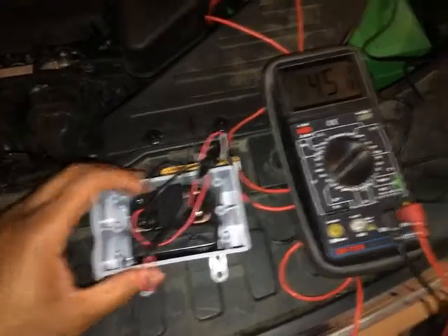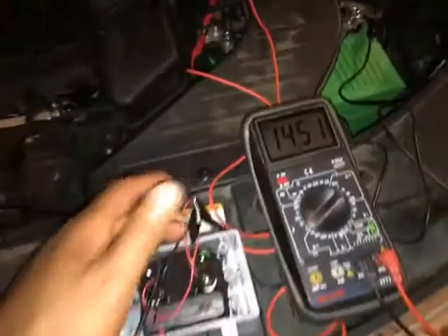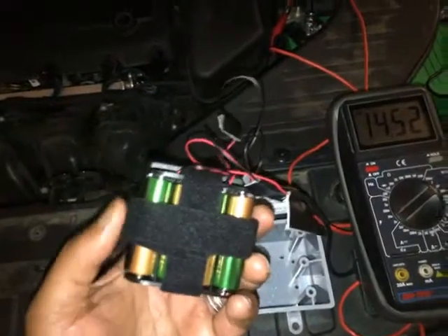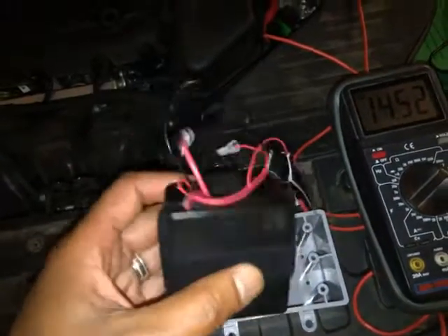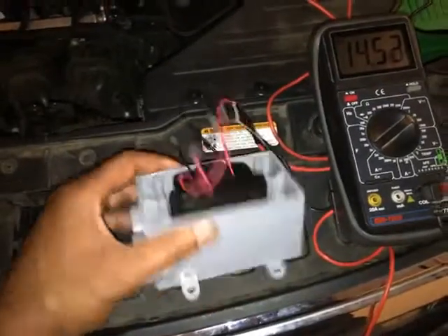My plan is to utilize this battery pack — I'm using a little container I had from other projects to hold it in place for now. I've got it connected and my plan is to put a diode in line so that this will supply power to the ultra capacitor but won't allow current to flow back to the battery pack. I'll just recharge these with my charger — I can charge them up pretty fast. With the switch I just turn it off, connect it to the terminals, then turn it back on, so there's no arcing or sparking.